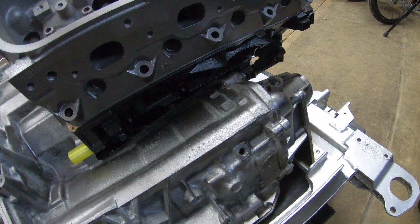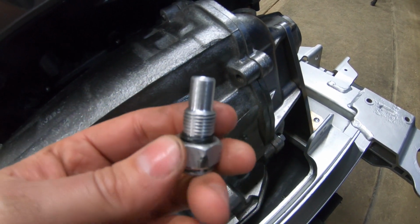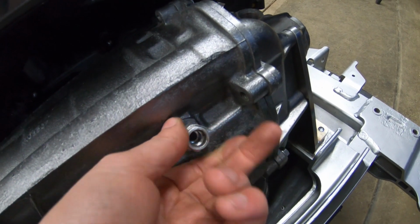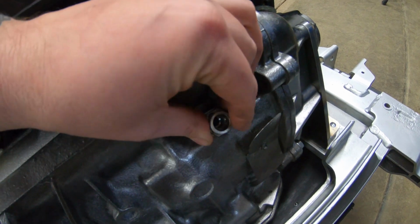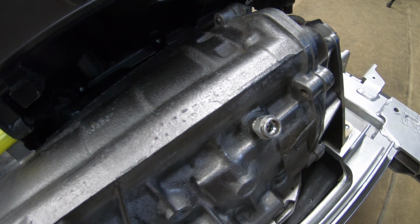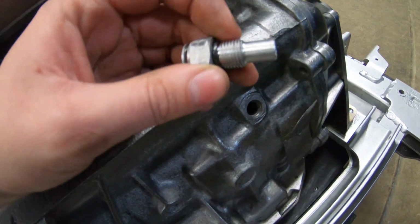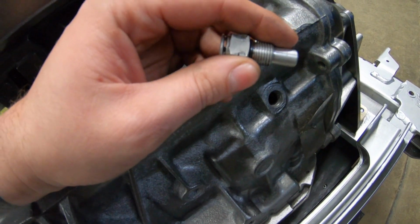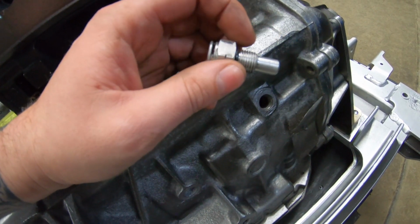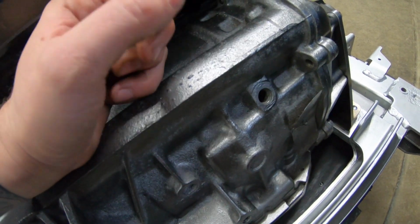Now in the rear, the cooler fitting has an extension tube, very much like the 4L80s. You need to be conscious of that when you're putting fittings back here. You don't want to put one without the extension fitting. So I think there's a couple companies that offer them, like Russell. I'll put a link with the part number to the fitting you should be looking at in the description of the video. But when you get it, just compare the length of the extension tube. I believe the 4L80 is a little bit longer, so that tube will just need to be cut down a little bit if you want to switch from a push connect style to an AN fitting for your hoses.